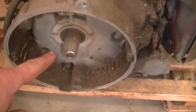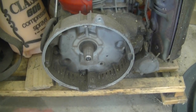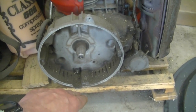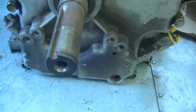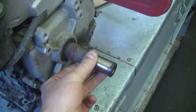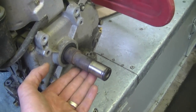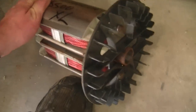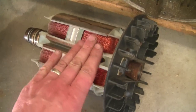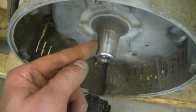The last question today is about tapered shafts on generators. A YouTuber is asking how he can reuse the engine on something else. Unless you're using it on another generator that requires a tapered shaft, the only way to properly reuse the engine would be to get another crankshaft from an identical engine. Regular shafts are usually an inch, five-eighths, or three-quarters and have a hole for a key — these engines are far more versatile. So you would just do a total crankshaft swap. Another option is to keep the armature, which is tapered, and machine it down — if you have a lathe you could do it yourself. You could also bring it to a machine shop, though that will be expensive. A machine shop could also make the shaft straight instead of tapered.